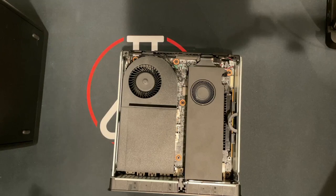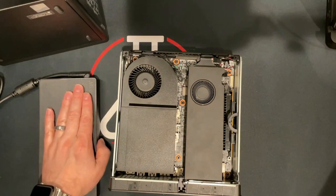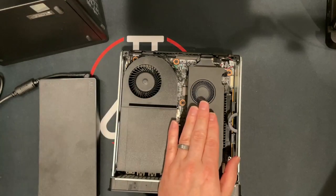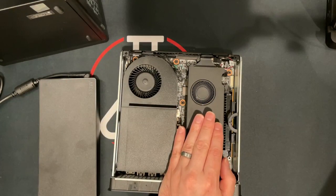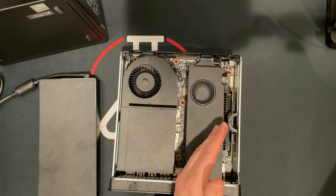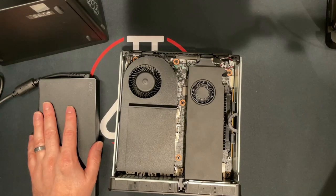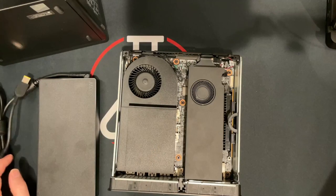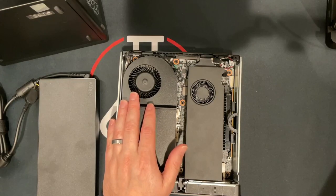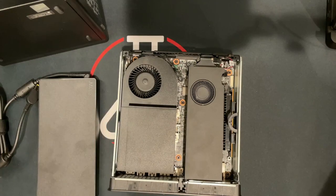The only thing that may end up being a problem is the external power supply — this is a 300-watt external power supply. The GPU is essentially what was the Quadro line; it's a workstation card and a very low-power card, so I'm not too worried overall. The one thing I'm worried about is that I probably won't be able to use something like the Pi-KVM's power functionality for remote power on and off. But that's a small price to pay for a very capable device.